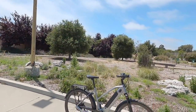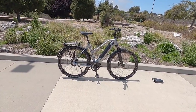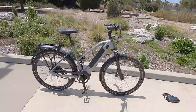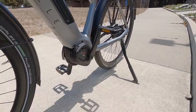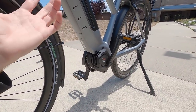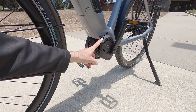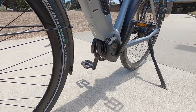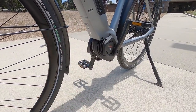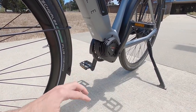So it's around $4,700–$4,900 — a little bit more expensive — but in the scheme of things, even though it's one of the higher-priced Gazelle models, you're getting a lot of really good technology, including the Bosch motor. This is their speed motor. The plus in C380 Plus denotes the higher-speed bikes from Gazelle — up to 85 Newton meters of torque, with excellent weight distribution. It's actually more compact and lighter than the older performance line speed motors from a couple of years ago, weighing about 7.1 pounds.